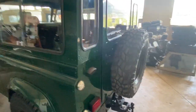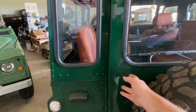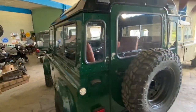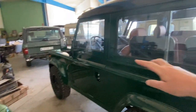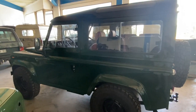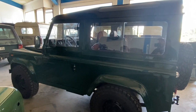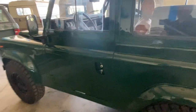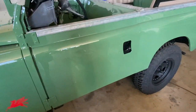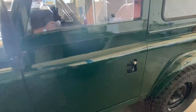This is also true in the rear — this is identical to a Defender rear door and it's all one piece. So you can remove the hard top but the door will still be sticking up — the two front doors and the rear door. When we convert a Defender 90 to a soft top, we also change the doors. As you can see here, we've backdated the doors to this earlier Series-style door with recessed pull-up door handles, but most critically no roll-up windows — the door and window section are two pieces.